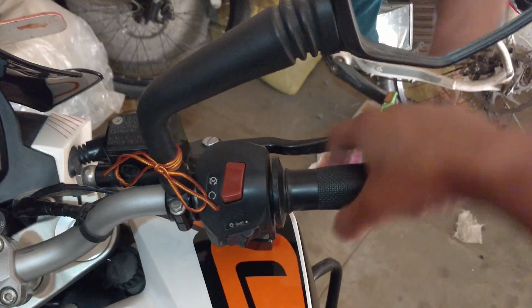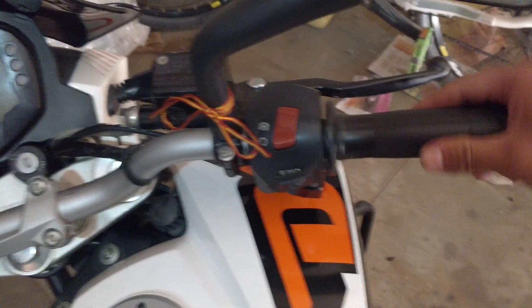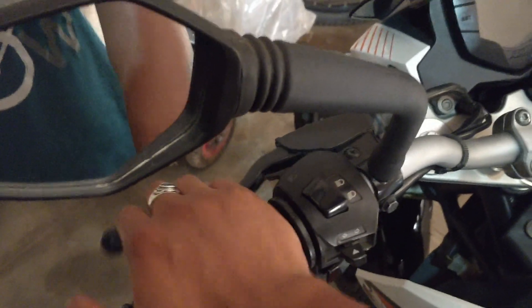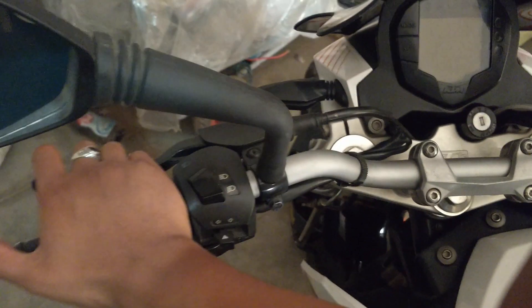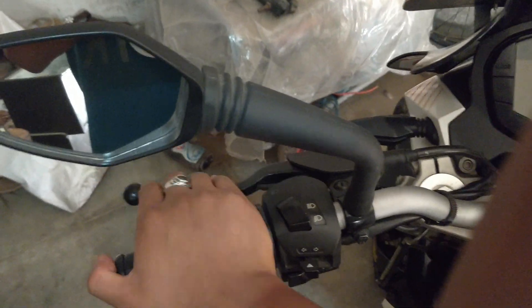Cables — check the cables, they look good. There is the clutch cable and the throttle cable. Check for wear; around 20,000 kilometers they may need to be changed. If you don't change them in time they can fray or snap. Budget around 2,500 rupees at about 15,000 to 20,000 kilometers.